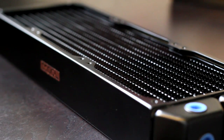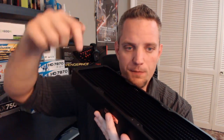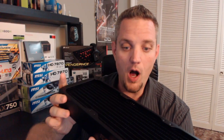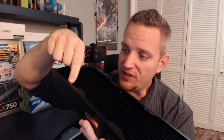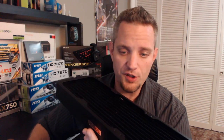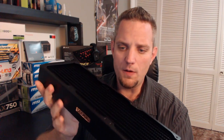What I really like is that down underneath the screw holes, even though these holes line up with some of the runs or tubes in this radiator, the Alphacool radiator has a plate that goes all the way around the mounting screws. On cheaper radiators, if you screw in too far the screw goes right into that channel, puts a hole in your tube, and your radiator is ruined. That plate is going to save you from destroying a very nice radiator such as this.